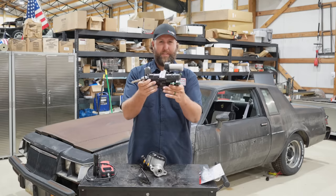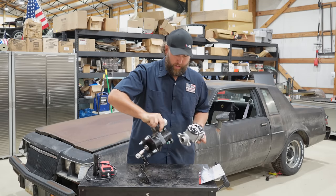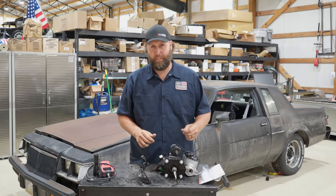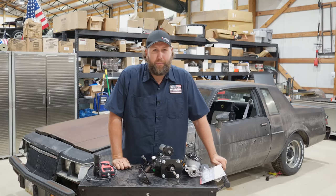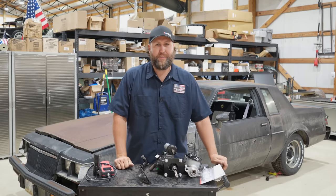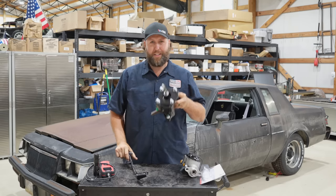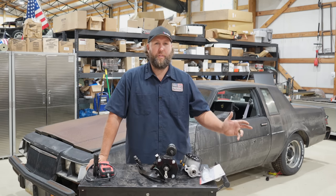Basically, this is the main unit here. It's got a bunch of pipes, hoses, and doodabs, and then you've got a typical master cylinder that goes right on the front of this. Now, how this builds pressure is it actually uses the power steering pump. That power steering pump not only supplies pressure to the power steering gearbox - not necessarily a rack, just a gearbox - it also sends that pressure up into the brakes. Hydro boost brakes. Since this unit is changing all of the pedal geometry and angularizations, you have to hang a new pedal in there.